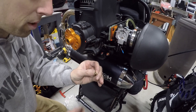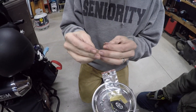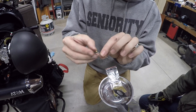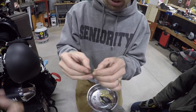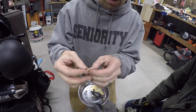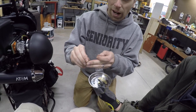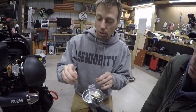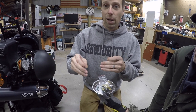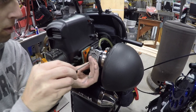The size of the hole on the new jet is hopefully a little bit bigger, allowing a lot more fuel into the carburetor. It's going to be really hard to see any difference there. The old jet still says 116 on here — it'll pass through on this metric drill bit but kind of gets caught towards the top. The new one also says 116 on there, but it's nice and loose — it has a little slop. So you can see how much more opening this has; it allows more top-end fuel. Full power is not going to die out in cold weather. You might see a little bit more increased fuel burn, but you're going to have power when it gets cold out.